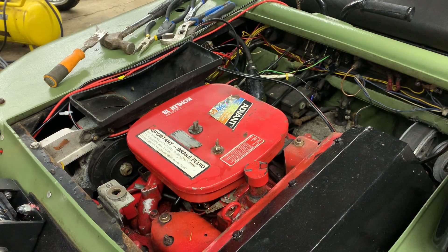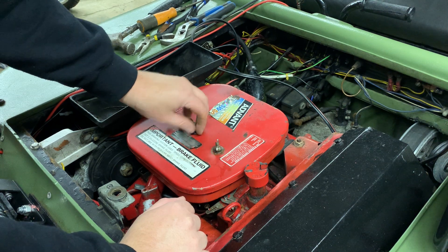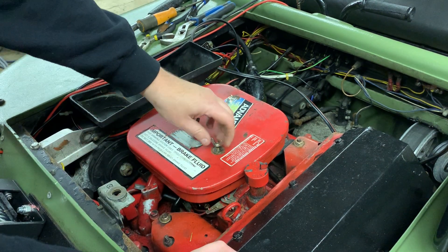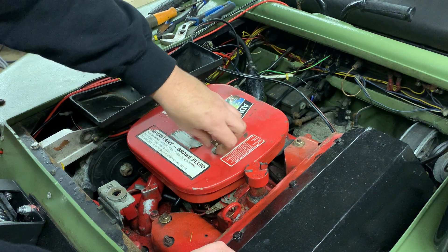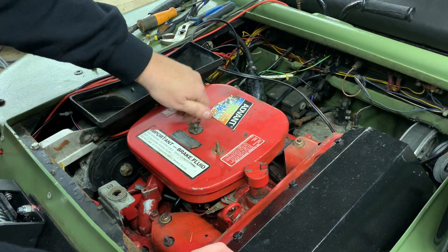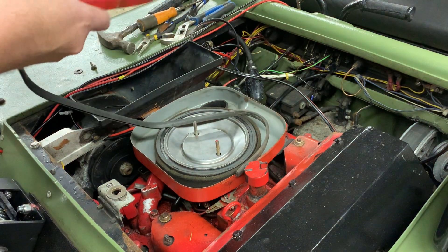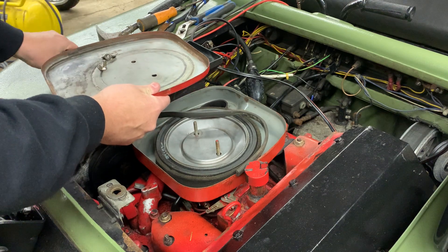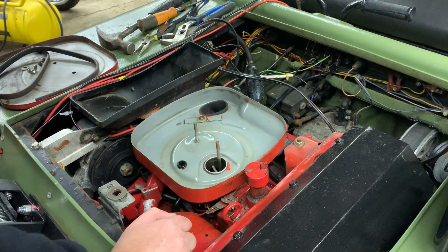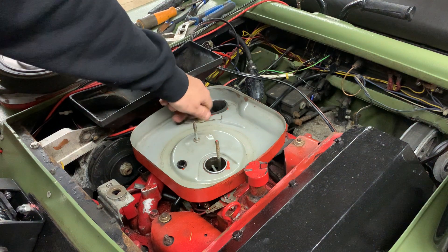Hopefully this angle is going to work. Let's go ahead and take off the breather box - I'm going to figure out the tools on the fly because I don't know what I need here. This Argo is kind of cool though - you can see down here she actually has a Chevy alternator, so I'm surprised that she's killing the battery. We will check all the wires and make sure that thing is wired up properly. These wing nuts just come off - there we are, a little gasket - and we have a nice little tray. I found a 10mm, seems to be the right size.